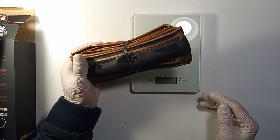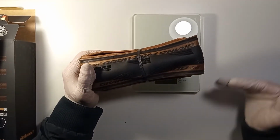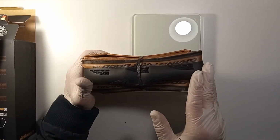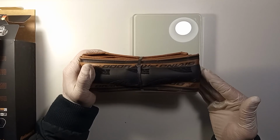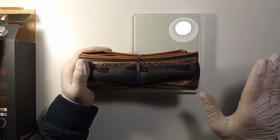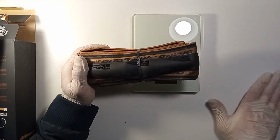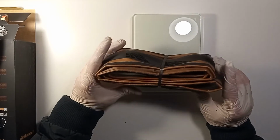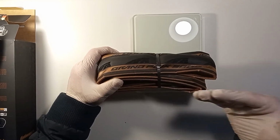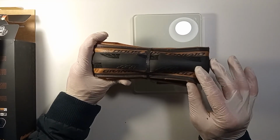I'm no tire expert, but one of the things they control for one tire, and sure, rolling resistance is also friction coefficient. If you have a really high coefficient of friction and really low hysteresis, you have the same rolling resistance as the opposite. So rolling resistance is the end result of several other things that come before. Now, there are some things they can control for one tire. They can control deformation or elasticity, which converts to hysteresis, and they can control the coefficient of friction of the rubber.